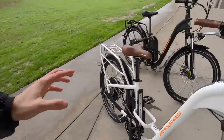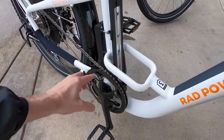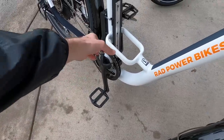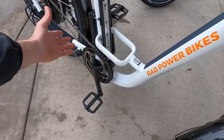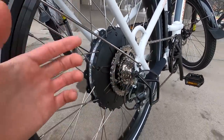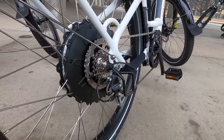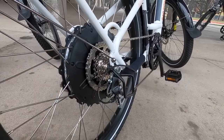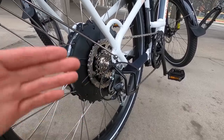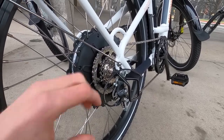A lot of their decisions — they don't go completely cheap. You've got an aluminum alloy chain ring protector that doubles as a guide, so that's going to help protect your pants and make sure the chain doesn't bounce off. Still a steel 46-tooth chain ring right there. But when we come back to the freewheel, it goes 11 to 34 tooth. This is DNP nickel coated, so it shifts a little smoother and it's not going to be rusting quite as much as a more basic cheaper part. So that's a real upgrade, especially the range on this — 11 to 34. Frequently I'm seeing 14 to 28 tooth freewheels, so good on Rad. That's a big upgrade for me and it's easy to overlook.